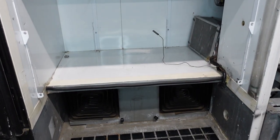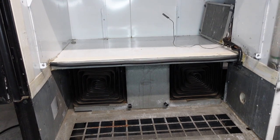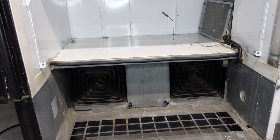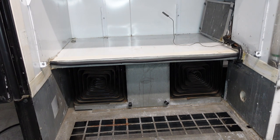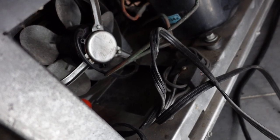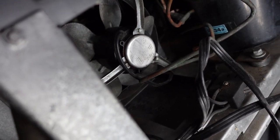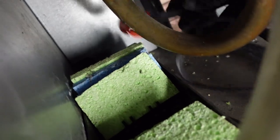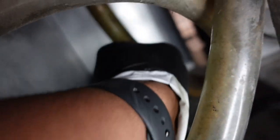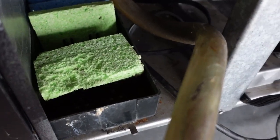As you can see, the compressor is now in and in position. Next, what we need to do is start making sure that it's properly secured and put back the shelves and all items required. Now that we have the compressor placed and everything is ready to be plugged in and secured, we need to first make sure that the actual power cord to the compressor is ready to be routed through the hole where the main power outlet is. Let's remove these first.